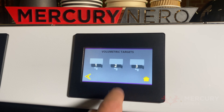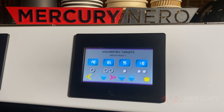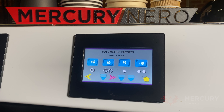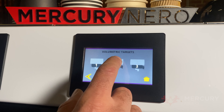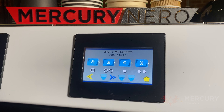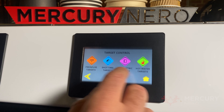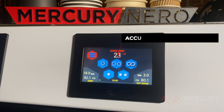The volumetric controls is where you dial in the volumes. For single shot it's 140 — that is 140 divided by 2, which is the amount in millilitres, so each unit is actually half a millilitre. You've also got the shot time targets. This allows you to set the recipe: 20 seconds for a single shot, 30 seconds for a double shot, 20 seconds for a ristretto. You'll see those numbers come up on screen — that last one was a double shot and you were seven seconds off.